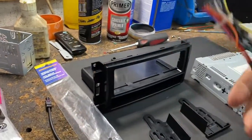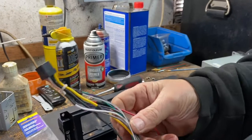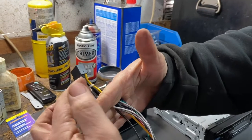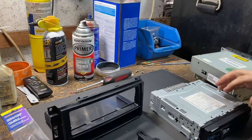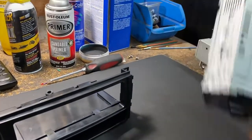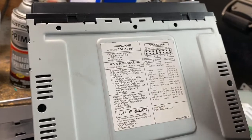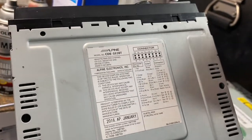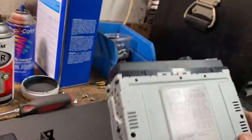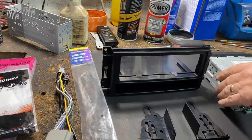The wire harness you're gonna get is gonna be like this — the wires are separate. In the back of any unit, it should have a diagram showing you which wires go where. I've been doing this for 40 years, so I know the wire colors, but you always still have to check — especially your yellow wire for memory, the red wire for switched power, and ground. Always use an ohm meter or a volt meter to verify proper voltage before you hook it up. You don't want to fry any wires or the stereo.